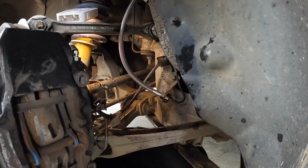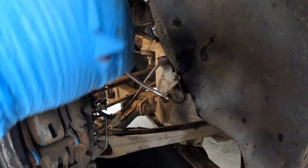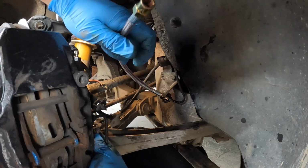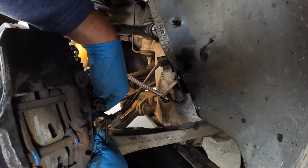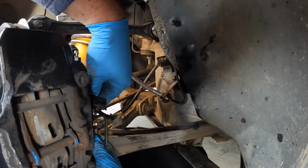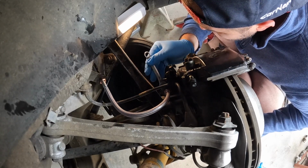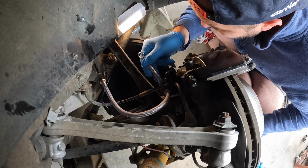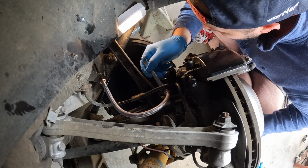All right, halfway done. Now I think I should do this quickly because that brake fluid's gonna start coming through here sooner than later. So where's that other end? Down low, I see it here. I'm gonna resume tightening this down with my regular 10 millimeter wrench. And then when we get close, I'll finish off with the crow's foot or at any point where I start to feel like it could possibly be rounding out the nut.